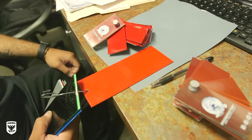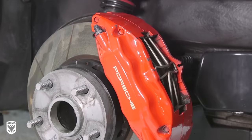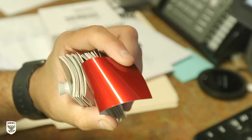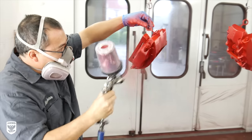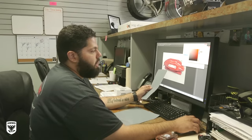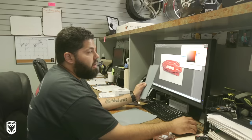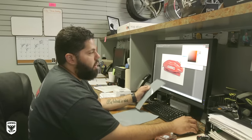Just as a point of reference, the panel right here is the standard Porsche caliper red — notice its lighter hue, which I didn't want, especially because it's an Audi. I ended up picking this darker pearl red, which requires a three-stage paint job: base coat, mid coat, and a top coat in high-temp clear. At the same time, we mocked up the Ammo letter color as well, which would end up being black based on its future track driving and how crazy I would be if white was used — keeping it clean would be a nightmare on the brakes.